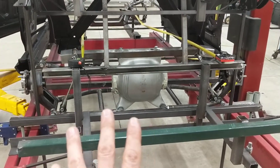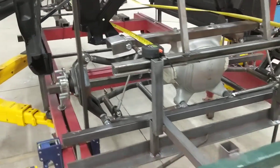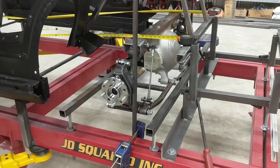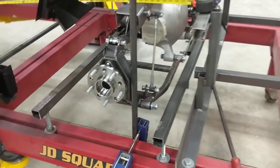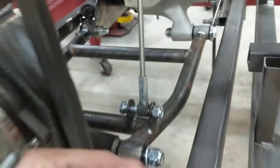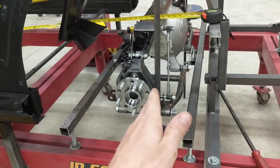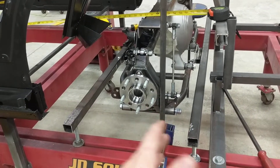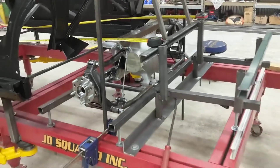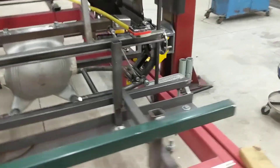So there was just a slight tweaking to shift the differential. The beauty of this IRS kit is that even if you get the thing off by an eighth of an inch, you have all this adjustability in these ends to where you could bring the rear end out a little bit or shift it forward or rearward just a smidgen in order to get everything lined up. But honestly, I think I've got it lined up correctly just like it is.